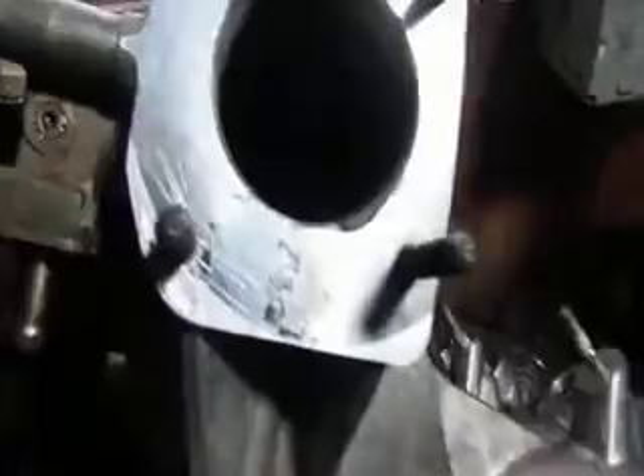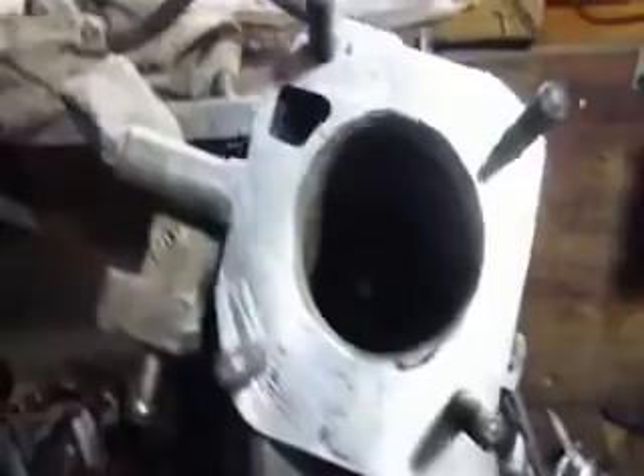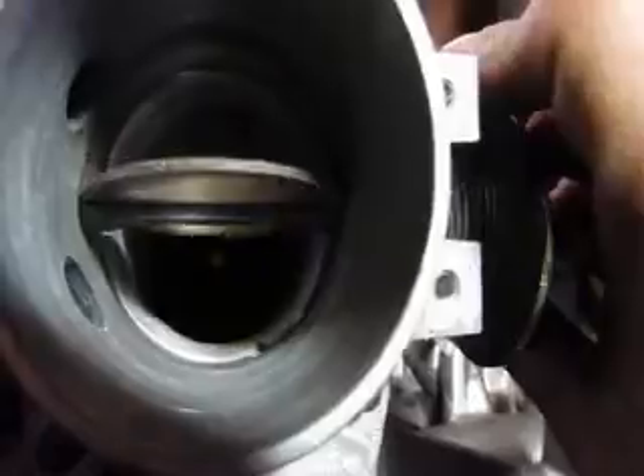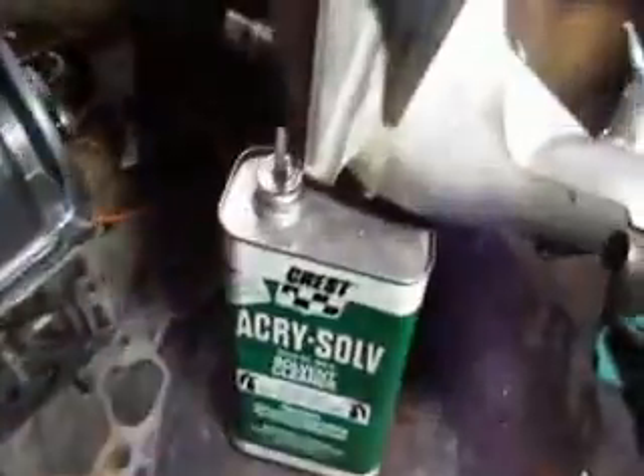All right guys, I just did the porting with the Dremel — well, it's more like a screwdriver thing, but this is what I used. I used a stone, just took off excess a little bit at a time, went all the way around in a circle. Just don't take too much off, because that could also impede flow, and volumetric efficiency is what we're wanting here. You can look inside there — you see that there's no step up like there was before. It's all smooth and it's all straight through. Pretty much perfect, as good as it's going to get without a machine shop.